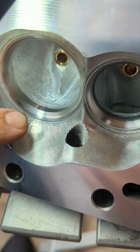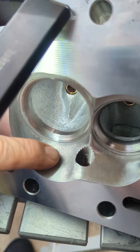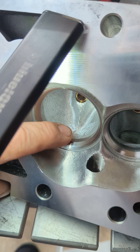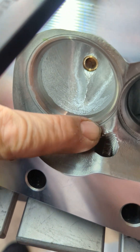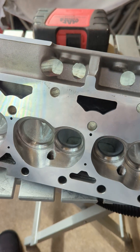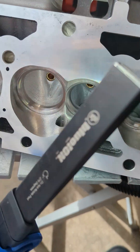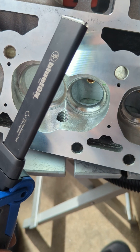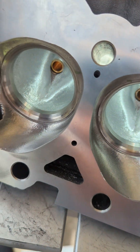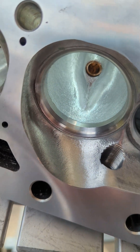You'll see a little ridge here. On cylinder head flow, you get your maximum flow from one inch on each side of the seat, so that area has to be completely smooth. There's a little ridge around the whole valve that has to be removed on all of them. Then the whole chamber and exhaust need to be polished so no carbon sticks. The intake gets 60 grit — they're burr-finished right now so they still need to be touched up.